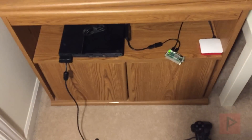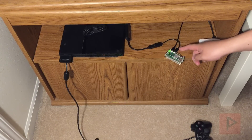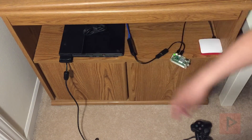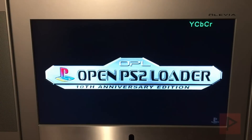We'll do the Pi Zero W first. What I have set up is one game installed on a microSD, then I have the power, an on-the-go micro USB to USB adapter, and then a USB Ethernet adapter connected to the PS2. So let's go back to the PS2 and showcase the performance and how well it works. I could use a USB adapter with a USB flash drive, but that's more components and gets a bit more cluttered. So I decided to copy the one game to the microSD using the Raspberry Pi command line, and it was not too difficult.